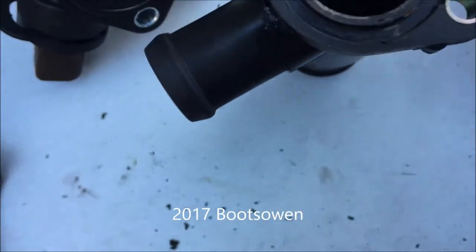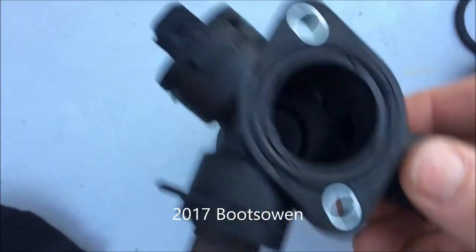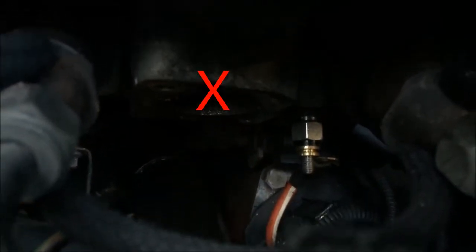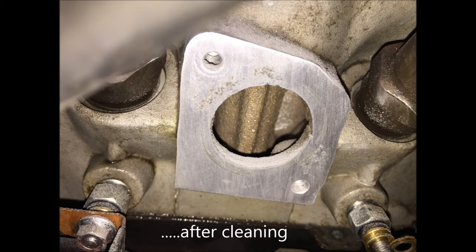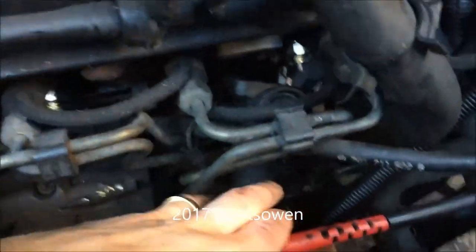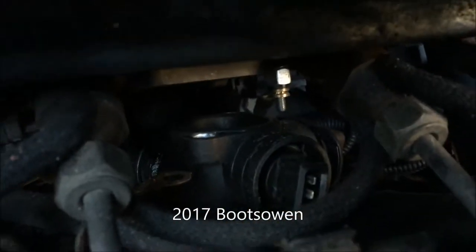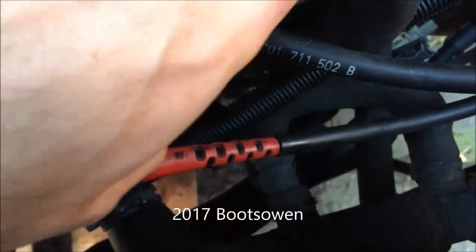With the old one out and compared to the new one, the old o-ring had a load of shmoo on it, and I suspect that if it was leaking, that's where it was leaking. The o-ring stayed stuck to the head when I took it off. The new one — the o-ring is welted in. I fitted the sensors back in, ready to put this back together. So this is the hose that I pulled up from the bottom, and there's the manifold and the cylinder head side. The only way to get this done is to take the hose off the bottom. I've got the new one in, hose reattached from above. The o-ring is in position and I've faced off the engine block manifold with a piece of sandpaper on a stick.